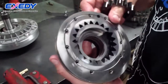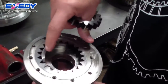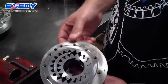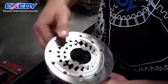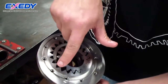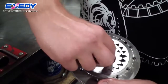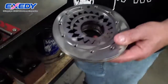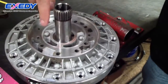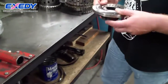Here we're installing the pump gears inside the pump body — the outer pump gear. This is what is called a priming crescent, to help the pump pick up prime. When the torque converter hub comes in and engages these drive lugs, it spins the pump with engine RPM. It will suck fluid up through one of these pockets, compress it, and deposit it into the other pocket, which moves through the pump and brings the fluid from the suction side to the pressure side, distributing it through the transmission.